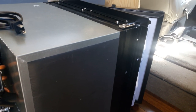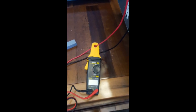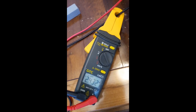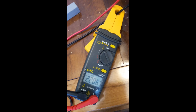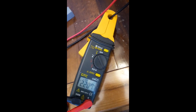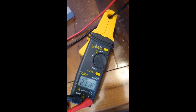We're going to do a little test this morning using an amp clamp. If you do not have one of these on your RV or boat, we highly recommend having one on board — nothing really makes it easier to troubleshoot electrical issues than a handy amp clamp. I just started the unit up on 12-volt and as you can see, as advertised, it's drawing anywhere between two and three amps. Settling out at 2.2 amps — that's pretty outstanding compared to other Danfoss fridges we've had. For boondocking, I don't think there's a better fridge system you can have on your RV.